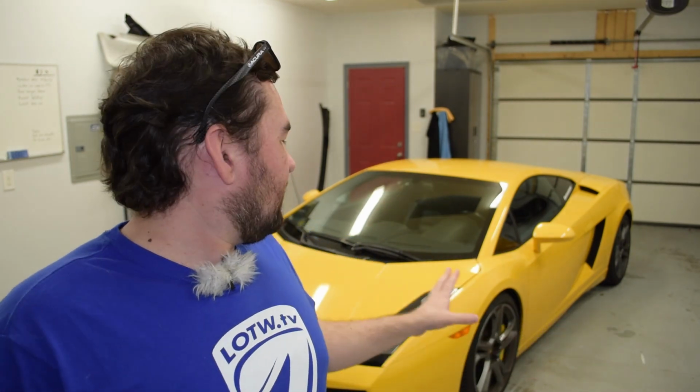The car is actually not throwing any check engine codes. I think you saw some error messages on the dash display during the acceleration pulls. One of those is a side marker blinking error, because this car has an identity crisis right now that I'm looking to get fixed soon. And the other one is a brake wear indicator, which is because the brake wear sensors on these cars are early generation and kind of garbage. I have visually inspected them with my eyeballs, and there is no brake wear concern at the moment.